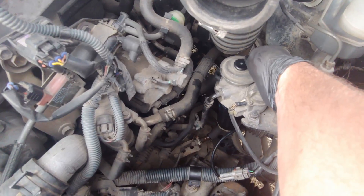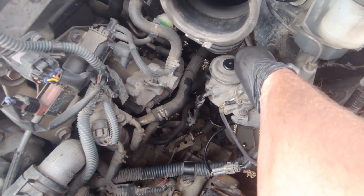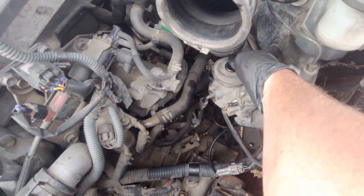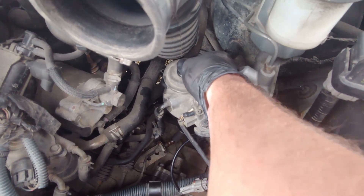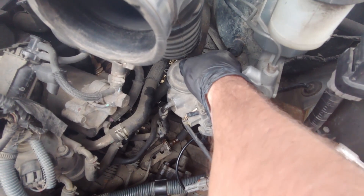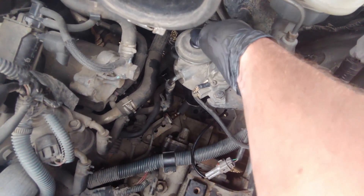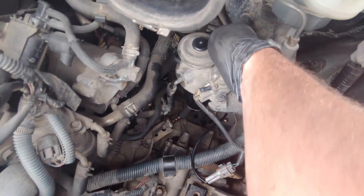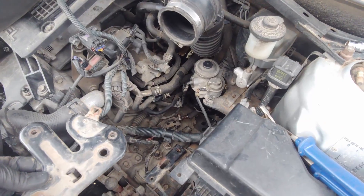If not, one of your injectors might be starved of fuel and it's gonna take a while for the engine to run right. Now it's not tight anymore, so we can pump it back and you can look for leaks too. Now it's very hard to press again, so we're just gonna hold on for a minute and do this a few times. Now let's put everything back.